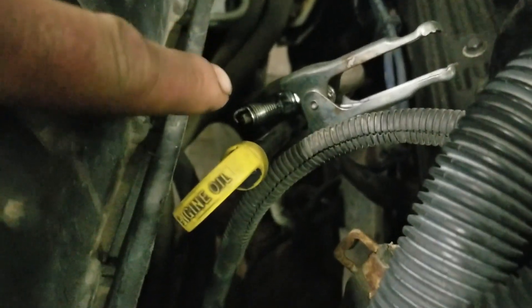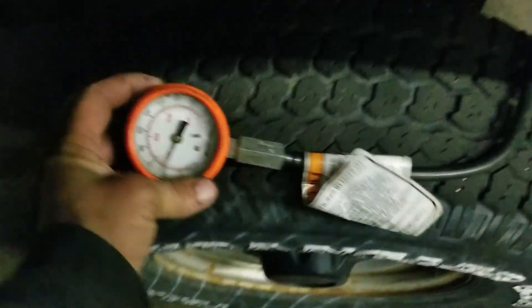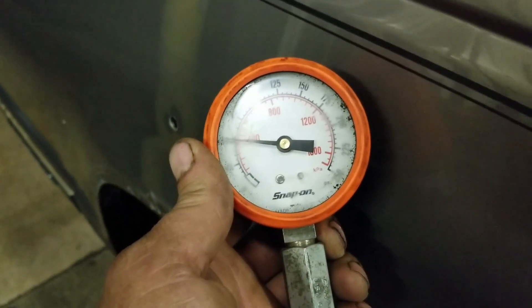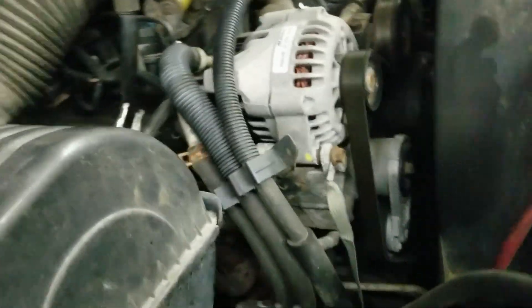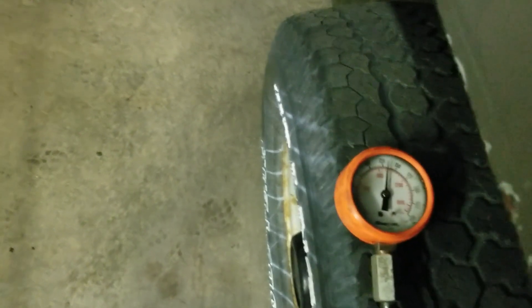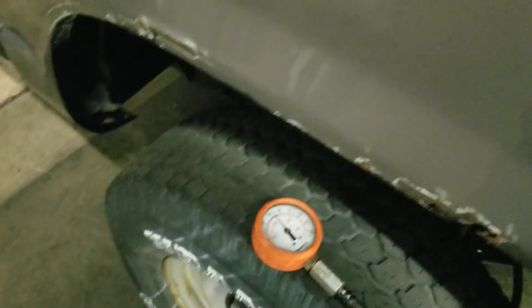Since I have the plug out, I went ahead and attached the plug to the dipstick with the clamp and threw the compression gauge in, just so I can start it up and see that I got some compression in the cylinder. I don't have a whole lot of compression for a cranking test — it's only giving me about 50. That's good spark though. I'm going to say that cylinder is extremely lean and not getting any fuel. I don't think I can have that much compression and spark that good and have any other kind of problem.